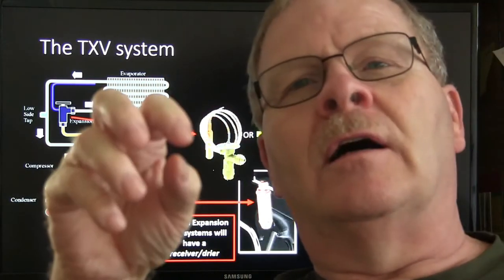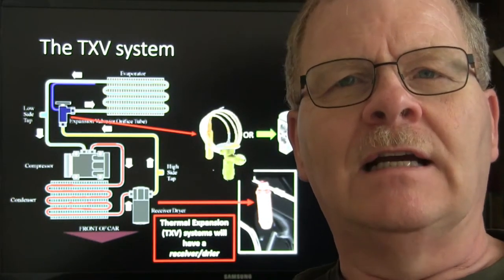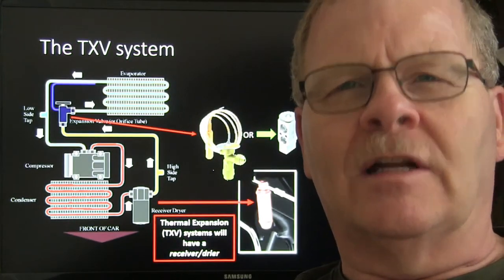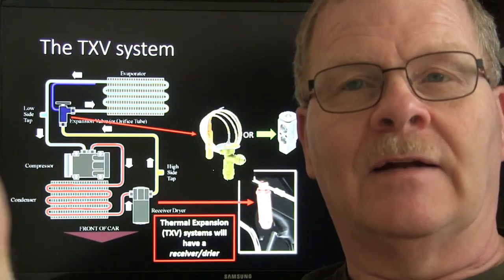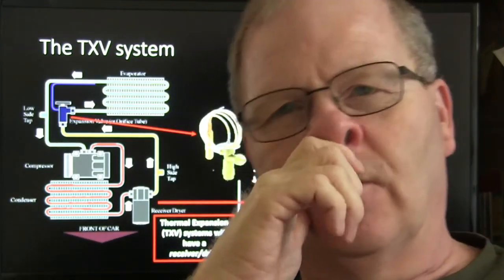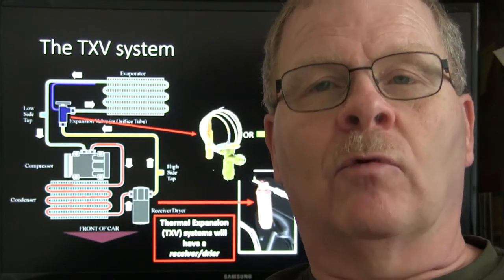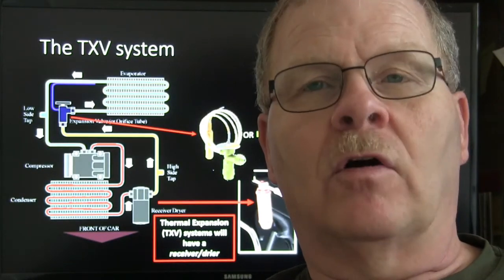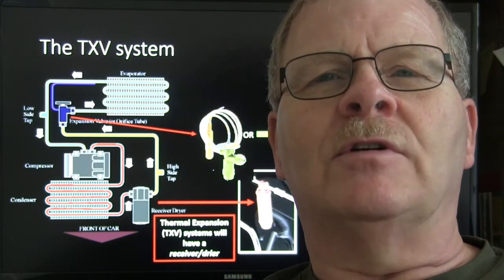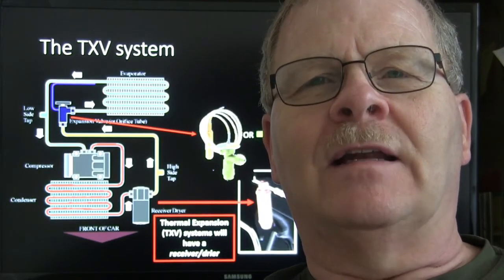Incidentally, when you're putting oil charge in there, you've got to have a certain amount of oil charge, because the way a compressor gets lubricated, it's kind of like a chainsaw. The refrigerant oil is going to mix with the refrigerant and go through the compressor to keep it lubricated. And when we used to do conversions from R12 to 134 years ago, you had to put oil in there that was compatible with 134, because the R12 oil that was used with that wasn't compatible. And so it would lock the compressor up if you didn't put the right kind of oil in there.